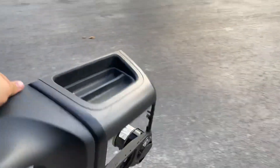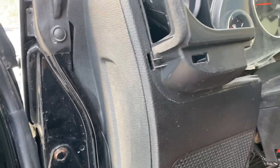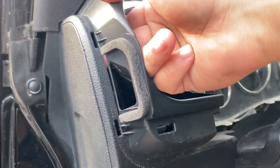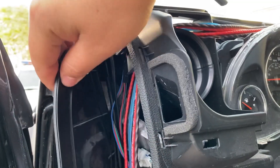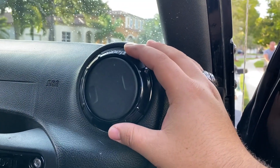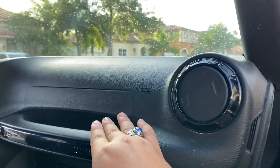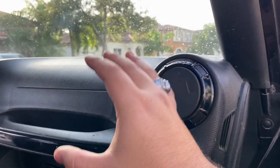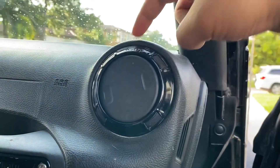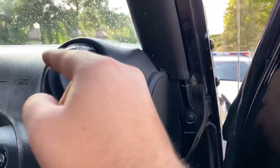Put this aside, make sure it doesn't crack. Next you want to remove this center panel — usually with a skinny flat head screwdriver, but since you already removed the dash you can just put your hands in here and pull it out just like that. For the passenger side, we're not going to be removing the whole dash because you have the airbag and we want to avoid that as much as possible. So we're going to remove this from here and I'll show you how to remove it from inside.